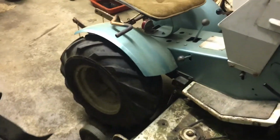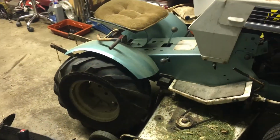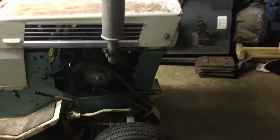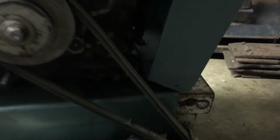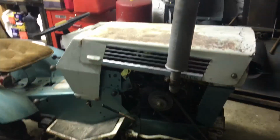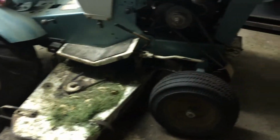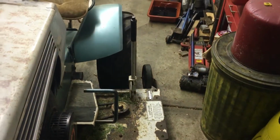Those are pretty decent looking. But I mainly got these for this tractor to help with the overall look, because I had to raise the hood, or the front grille on the front, to accommodate for the engine. Sorry, the lighting is kind of poor. I have a dead light. But the hood actually now sits level with the ground thanks to the taller rear tires. I just had to re-level the deck today. Front tire wise, because the track width is much wider in the rear now than it used to be. It's about 2 inches wider at least, measuring the back spacing and the rim.